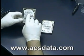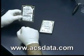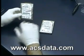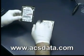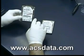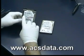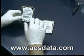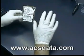We typically have to match up the model number on Hitachi drives — that's the primary parameter we try to match on these drives. We also try to get it fairly close to the same manufacturing date. Really when you're swapping hard parts in these drives, the model number is the main thing you're looking at. Some of them get much more detailed than that — they have different head maps, things like that.